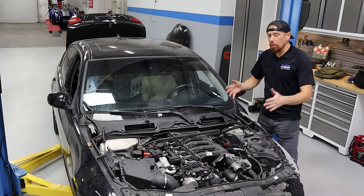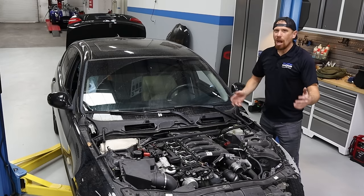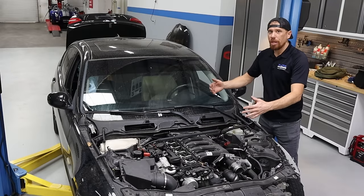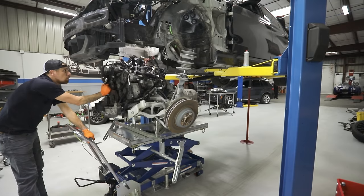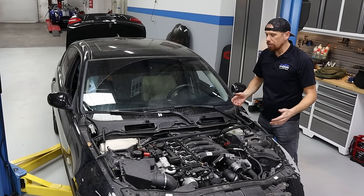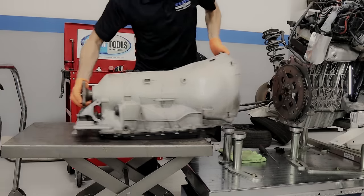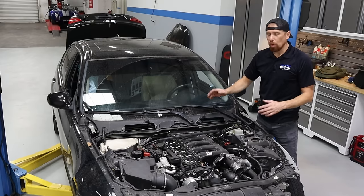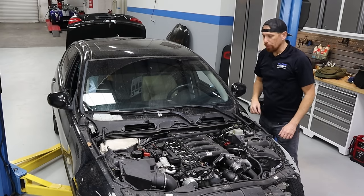There are two different ways to remove the engine from the car. We can pull it right out the top, which is a little awkward and clunky, or what I prefer to do is take the engine and transmission with the subframe and front suspension and just drop it right out the bottom. There's a little more work involved, but it's actually a lot easier. Things tend to go a lot smoother, and then once we get to that point we can separate the engine from the transmission, put the subframe and suspension back in, have a rolling chassis, push this outside, and start working on the white one.